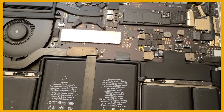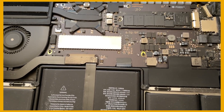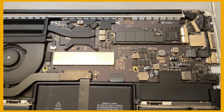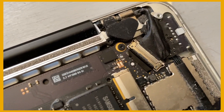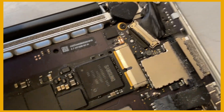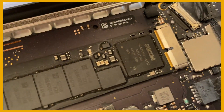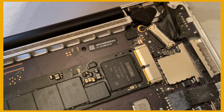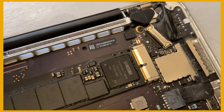At that point, I recommend opening the computer back up and holding the power button down for about 10 to 15 seconds. That drains the battery so you don't have to worry about frying the board or anything like that. Then right up here you have what's called the ribbon cable — it's what connects the screen to your motherboard. There's a little piece of black plastic at the front of it. You just peel it up, pop it back, and simply pull the ribbon cable out. If you hold by the little metal parts, you can just wiggle it out.